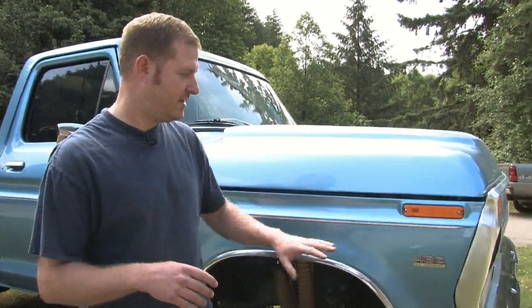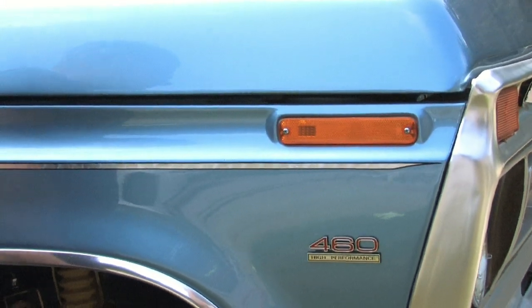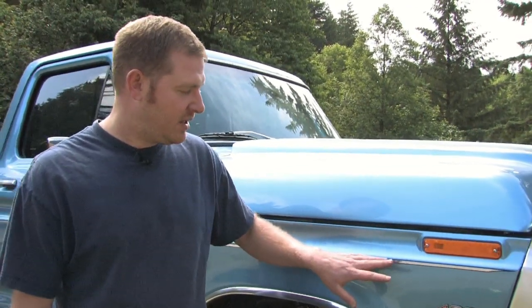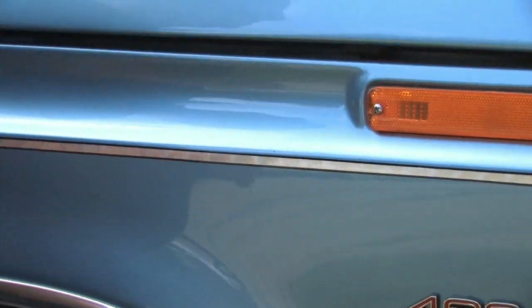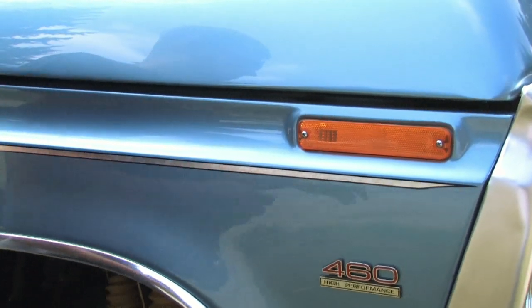Some other tips that can make your paint job look very custom without custom colors, clears, or candies is just by the addition of custom pinstriping. This is a silver leaf with two eighth-inch black pinstripes on top — it runs the whole length of the truck. You can apply these before or after clear coat. This one's on top of the clear coat, so you need to be careful about polishing because the pinstripe and silver leaf is pretty fragile. This can also substitute trim well, so you don't have to buy replacement trim or can fill dented trim holes and then pinstripe with silver leaf later.